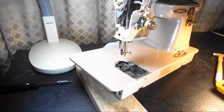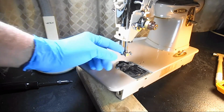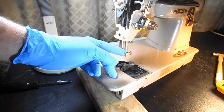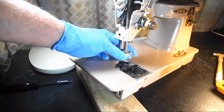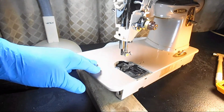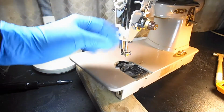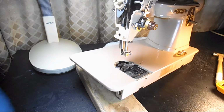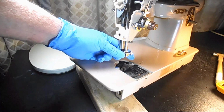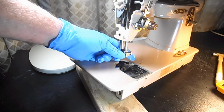This is AndyTube. In this video, I'm going to show you how easy it is to remove and replace the needle bar on a Singer Model 503A. This would also cover the 500A because they're very similar up here. Okay? So the first thing that we want to do is remove the needle clamp and thread guide down here,